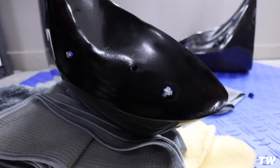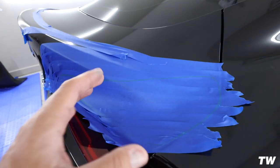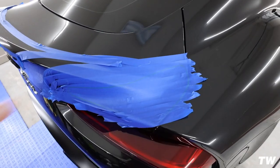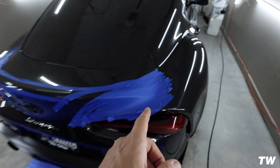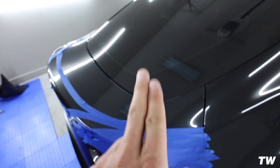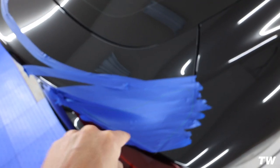A little bit of anti-seize lubricant on the paper — that's why you draw the outline, because you want to have a guide to actually put it on, rather than just putting it on and trying to move it around, which is just going to smear your lubricant everywhere. From there, we'll be able to actually pivot out where we're going to drill the holes. When we drill the actual holes, we're going to start with a little bit and then use a larger bit, and then from the other side use an expanding bit to open up that plastic a little bit. When you first pilot through, don't go all the way through — just pilot the first little hole.